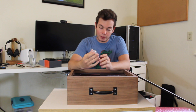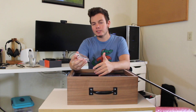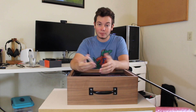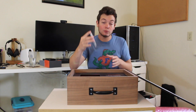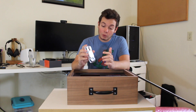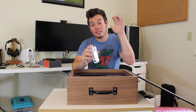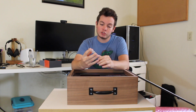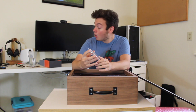For those of you that don't know, this is an 8-core, 16-thread processor that can turbo up to 3.7 GHz and is actually overclockable. With a little tuning, you can get it up to the performance of an R7 1800X, which is a $500 processor, which kind of rivals the performance of an i7-6900K, which is a $1,000 processor. So for $330 this is retailing for, it's an amazing deal. I've actually seen that price already start to come down - I've seen a couple sites showing you could get this for sub $300 with the Wraith Spire cooler, which is an amazing deal.